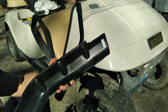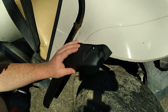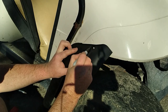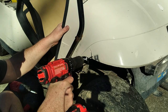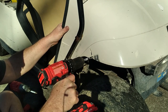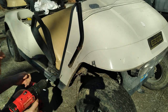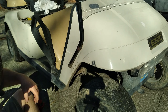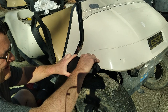Just take your fender — it is marked on the inside to indicate which side it is. What you're going to do is line it up. It's rather easy; you just line it up with the lines available on the golf cart. Mark yourself a hole in the center and square it up. There's a break in my golf cart right there but it'll be fine. Drill it out and take your bolt — there's already a built-in washer — and slide that in.